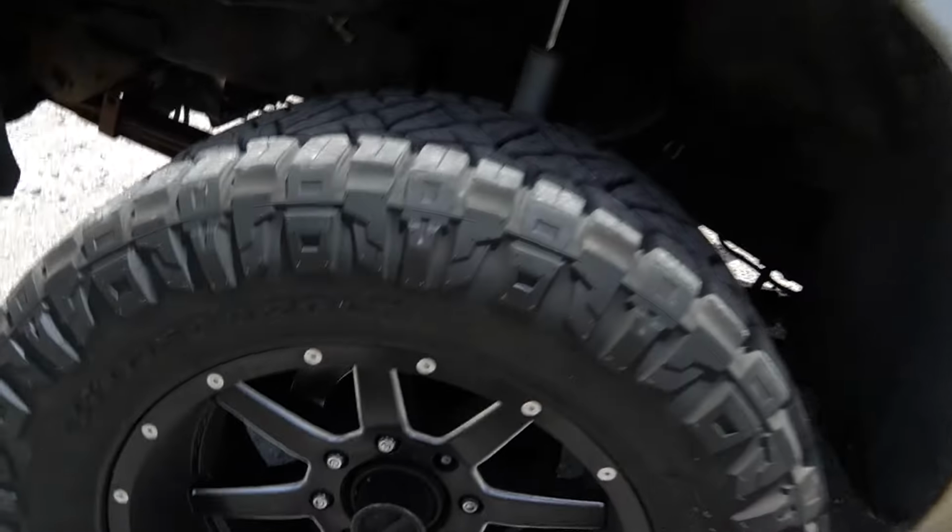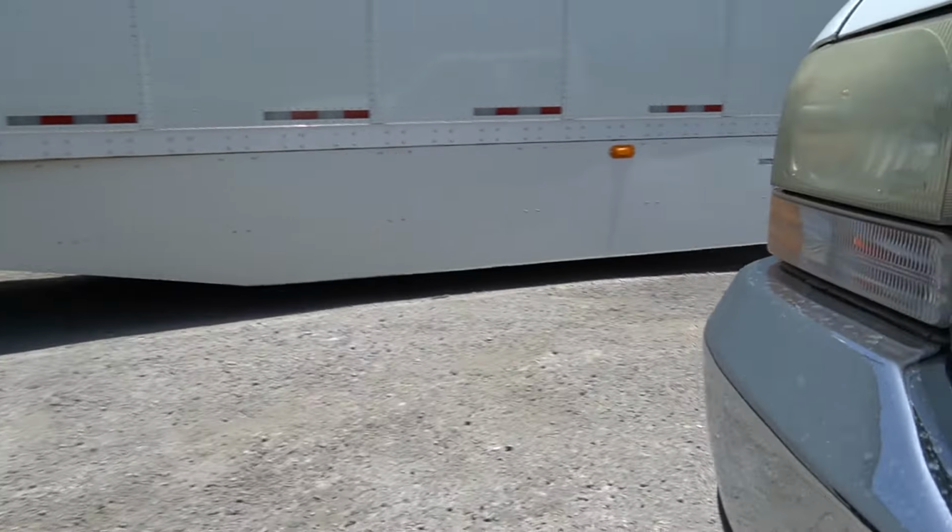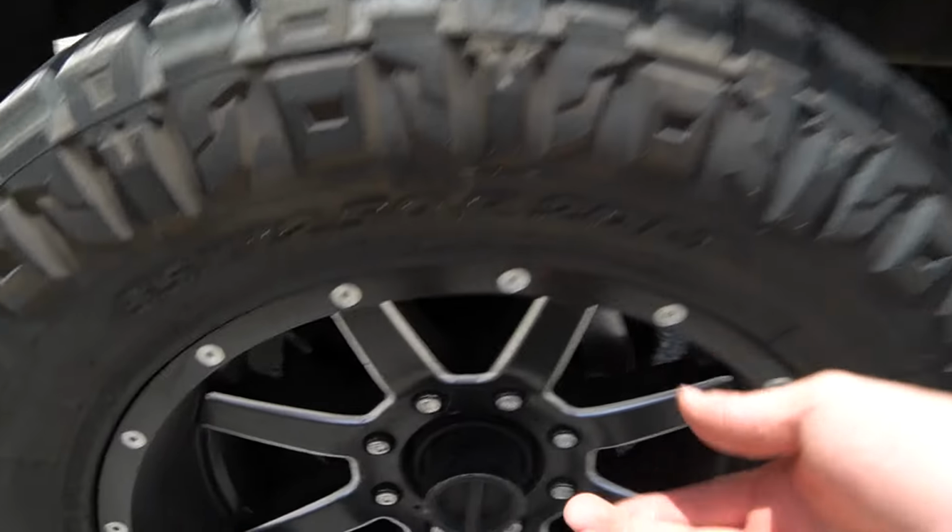That's a very in-depth video on how to do it. And we basically went driving around as well for you guys. So I'm gonna unlock the hubs, show you guys how to unlock the hubs and everything, and then we're gonna conclude out the video. So stay tuned. To go ahead and unlock the hubs, you gotta make sure you do this, guys. Unlock, and this guy over here is gonna be an unlock as well. Just like that. Now, that's pretty much how you engage the four-wheel drive.